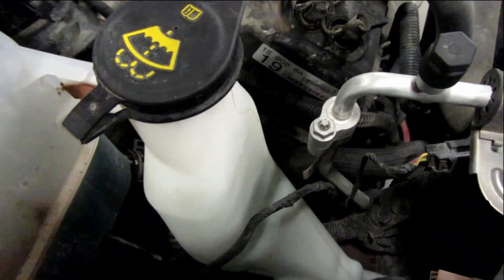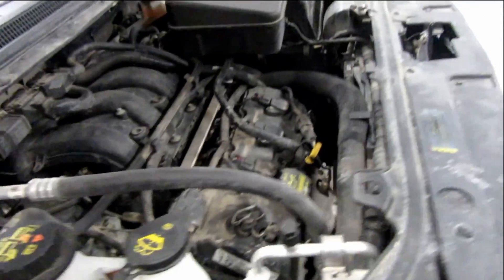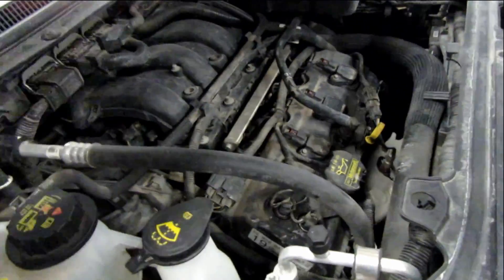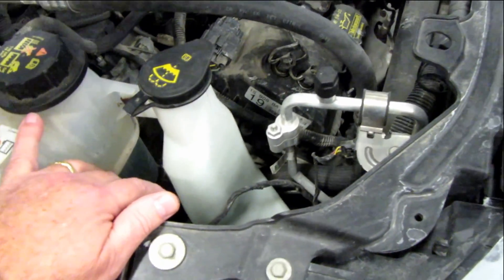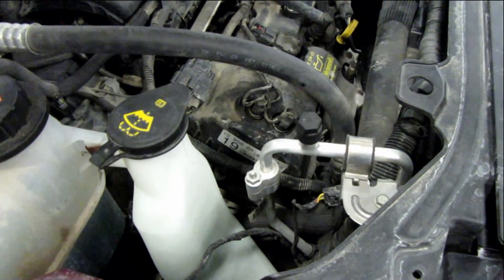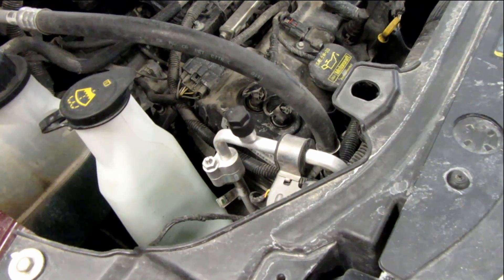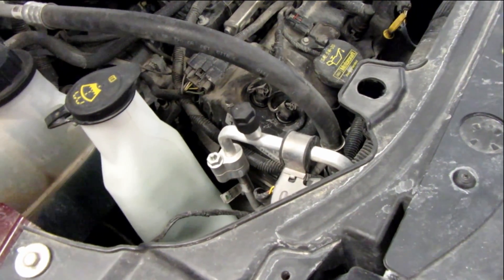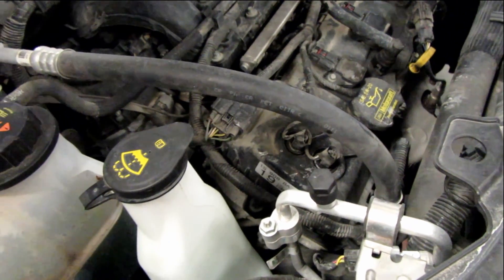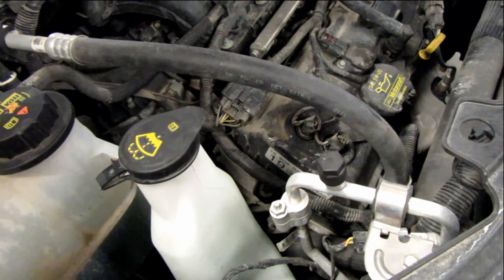So this is going to be a fairly long job just trying to get all this out. My mom's Chevy truck — the alternator is sitting right on top, you just take it out. Two bolts and a few nuts on the wire and you're done. This has apparently been doing this for a while, so whatever's wrong with it is semi-permanent. It charges just enough. Thankfully my driving is all highway, so I'm keeping the RPM up higher and I am getting a charge. But if I drive around town, all bets are off.